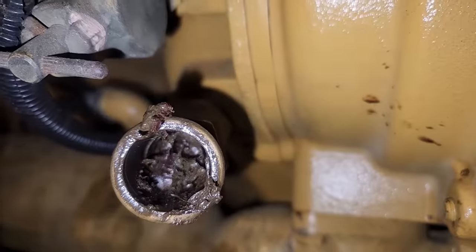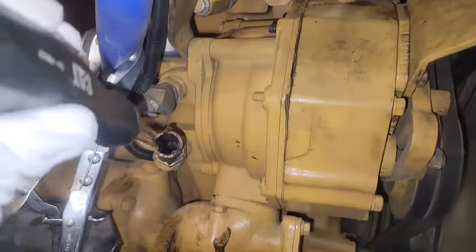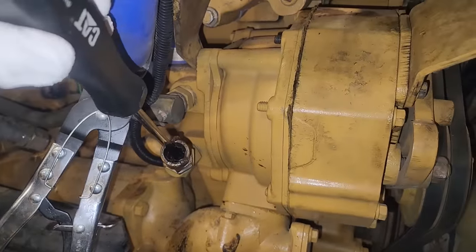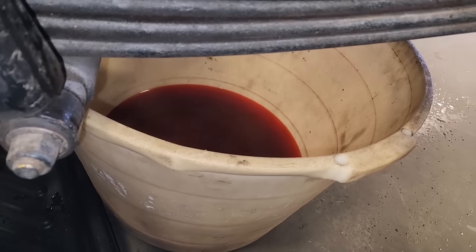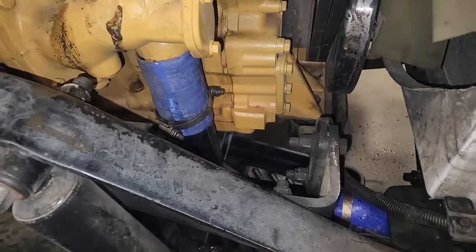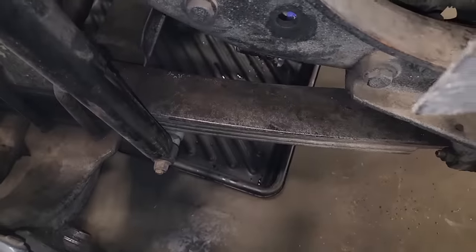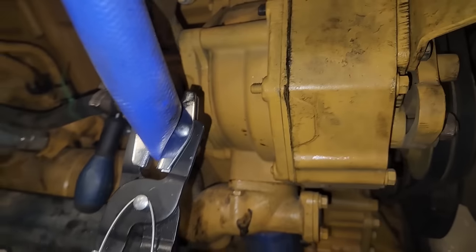Remember the coolant's red, so that's why it looks reddish. The shunt line is completely plugged off. The hose itself had coolant in it going toward the water pump, but it was not able to get coolant or air out. You can see how little coolant came out — nothing else was coming out. I took the container away and hooked up the shunt line again. This is the tube between the thermostat housing and the water pump. You can see the clamp's off, hose still in place, but no coolant's coming out.